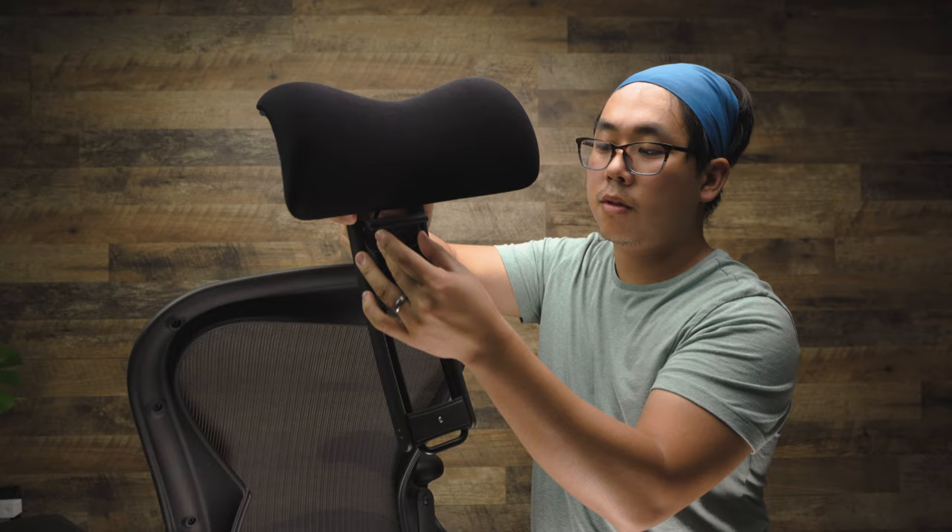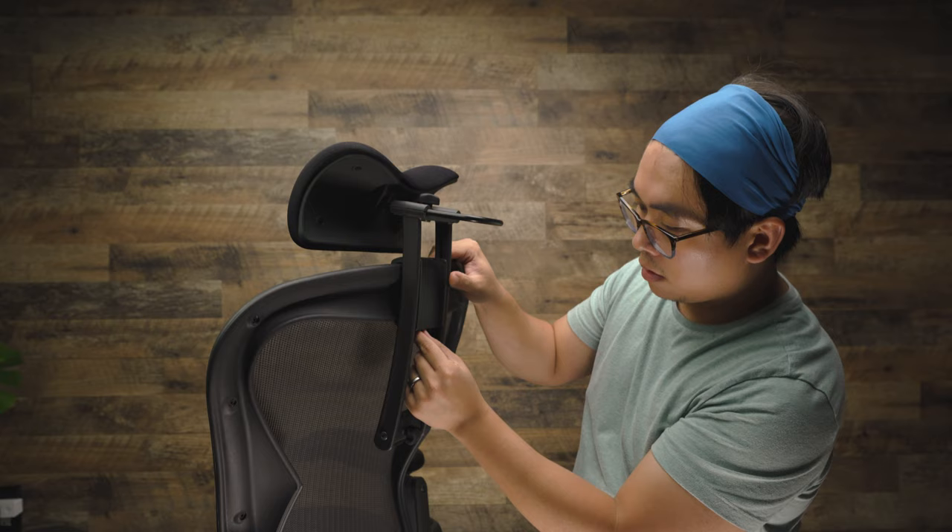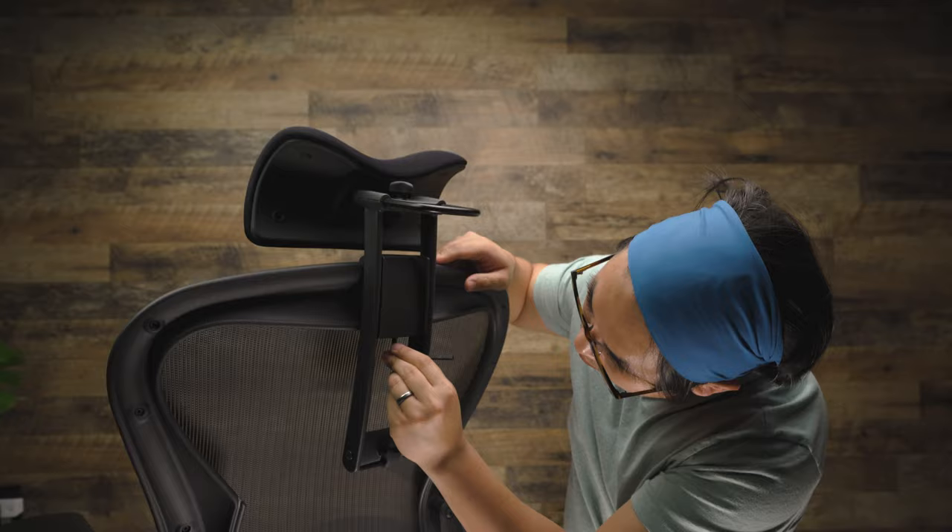To install these headrests the process is near identical. For the fabric cushion headrest it comes fully assembled — find the top clips, put it into the divot of the back seat rest, lower it down, make sure you screw in the hex screw a little bit with the bottom hooks underneath the overhang of the chair, and once you find center you tighten that and you're good to go.